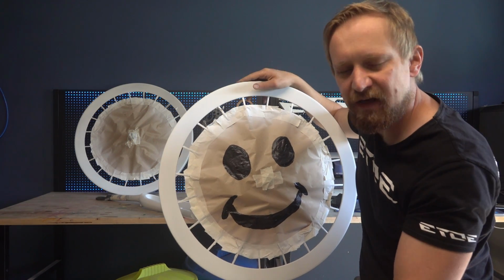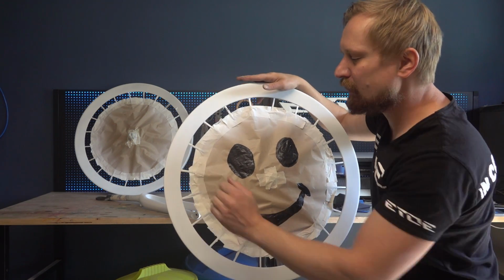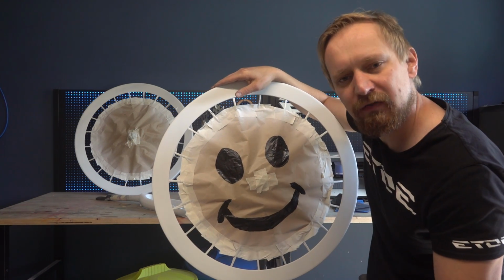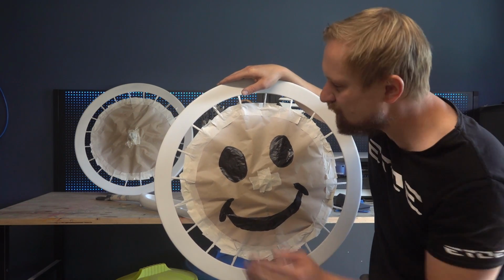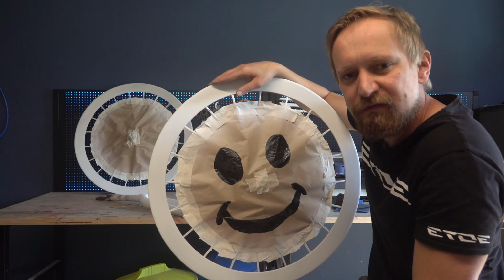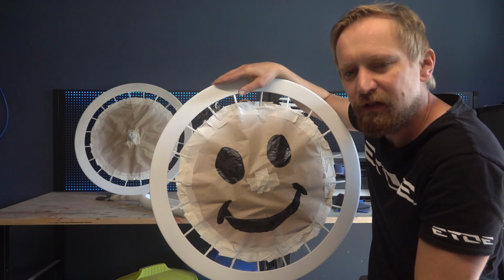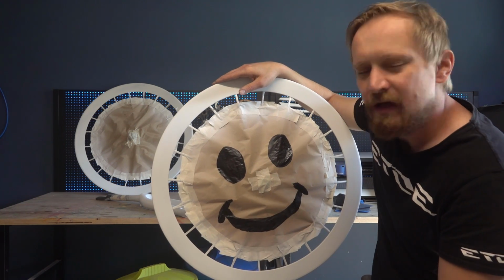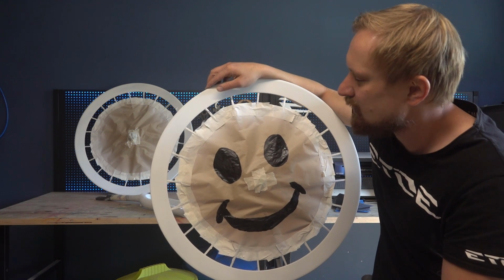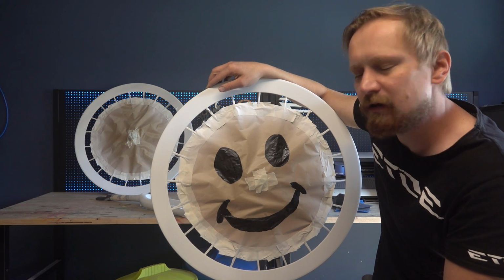If you have an open and woven carbon fiber material like on these rims, you have hundreds of little pinholes in between these carbon fibers. Pinholes are little holes in between every fiber and the layers of the carbon material, and they need to be filled before we can start painting. And to fill these holes, I use the primer. The carbon primer is used to get adhesion between the carbon and the layers of color, but it's also used to fill these little holes.